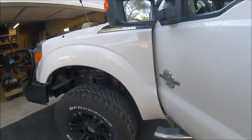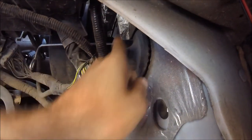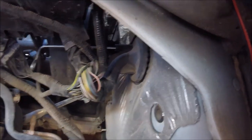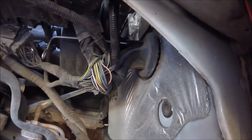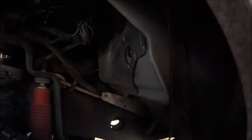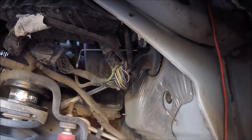You can put wire loom around your wires, and where it meets up coming through here you could wrap that wire loom around this and wrap it with tape, or even put some silicone in there. I've done a ton of wiring and figured out all the little nooks and crannies of this truck, and I just discovered this finally. So if you don't want to use the ones Ford provides for you right there to go through the firewall, you can use that and it'll seal up pretty good once it's done. Hopefully this is helpful to somebody because I've never seen it before.